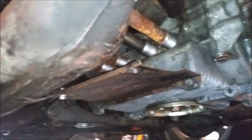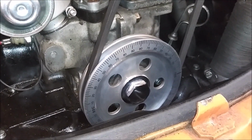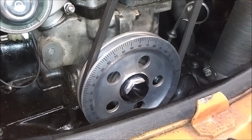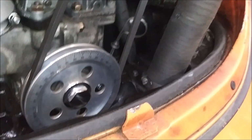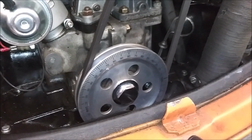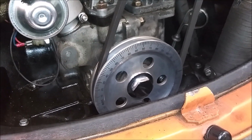We have a valve cover on this side, and on the other side. We're going to start on the other side. So all we've got to do is get my giant wrench, put the car in neutral, and rotate to top dead center on cylinder 1. We'll pull the valve cover off first to make sure we're on cylinder 1, not cylinder 3's top dead center. You can also look in the distributor to figure that out. But I'll just look at the valves themselves on the cover, and then we'll adjust our valve lash.